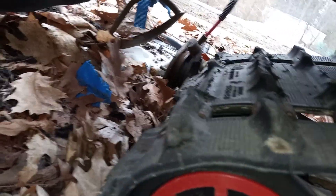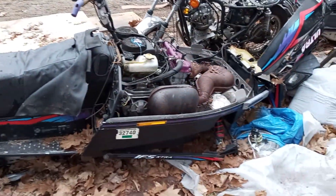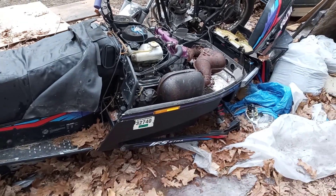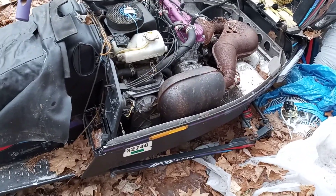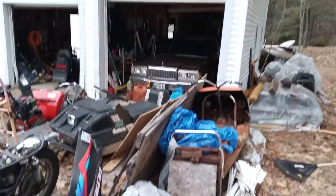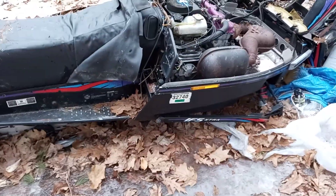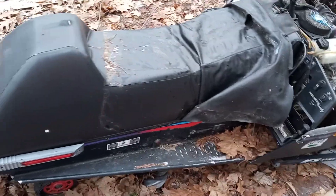This chassis unfortunately has been through hell — it's bent and twisted. This radius arm mount right here has been driven backwards a good inch or so. I actually thought about lag-bolting some plates with hooks welded to them to the garage floor and using a floor jack and engine hoist to try and bend it back into shape, but I found that other chassis not long after, so I decided to just swap everything over.